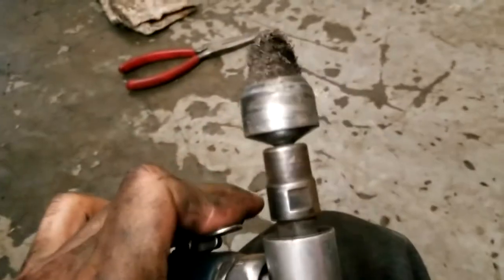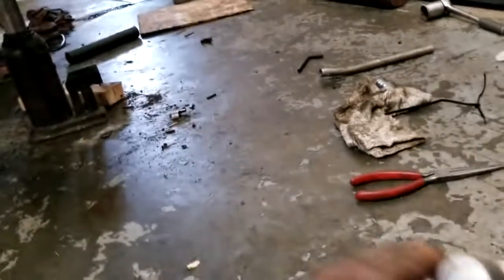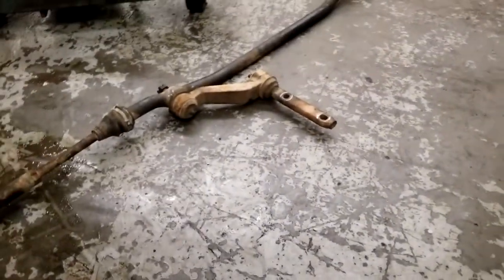Now, I think the next thing I'm going to do is the steering rack, which I've got some cleaning to do, which I know you can't see. You can see the stud, but I've got to clean that one up and the hole for this one and a couple other things, because when it was coming out, it was not happy. So I'm going to use this, try to clean some of the stuff up, and maybe get a wire wheel in here to clean up that stud. And hopefully, if it ever has to come off again, fingers crossed not, knock on some wood, do whatever witchcraft I have to do and make sure I don't have to take this thing back apart. But if it happens, it should come out nice.